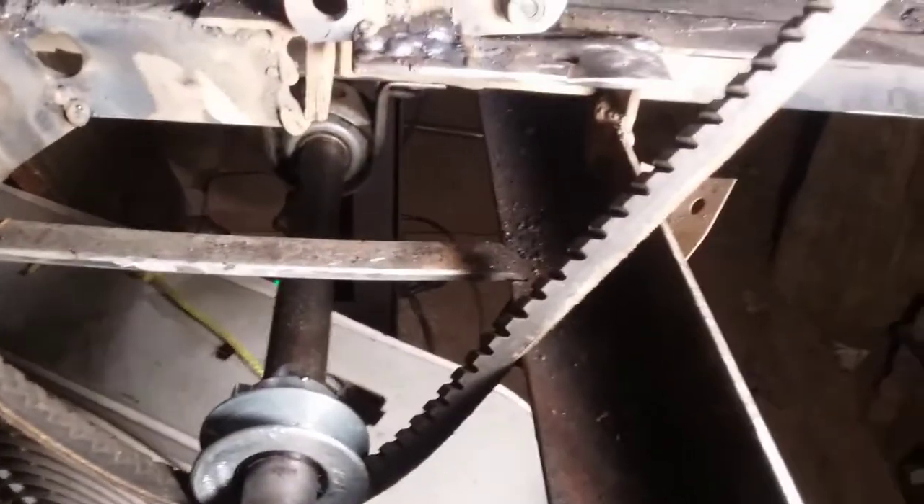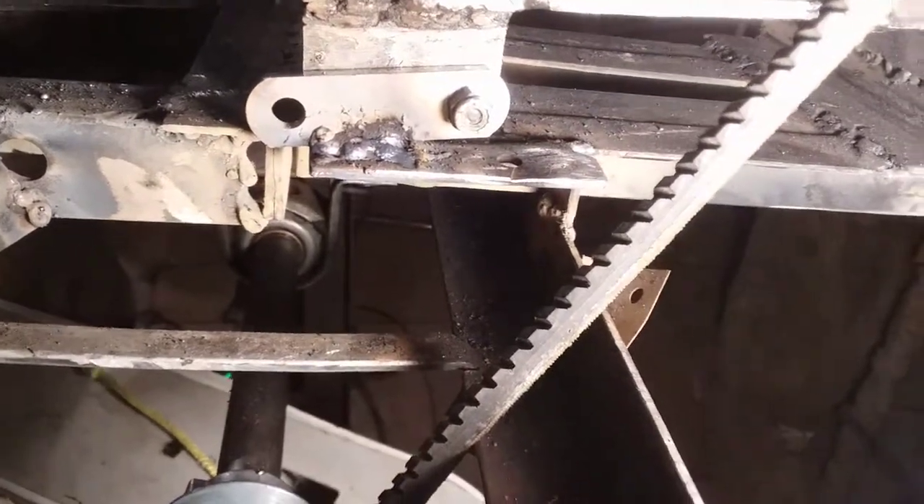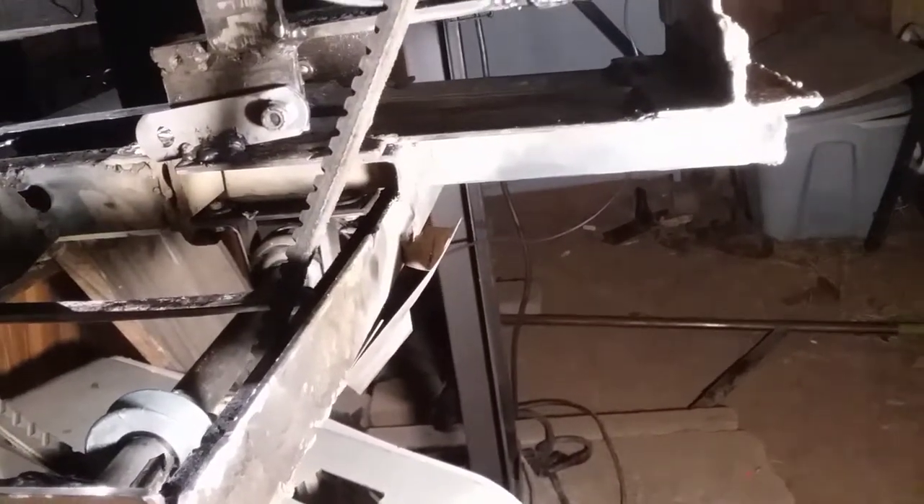There's another mount like this on the other side. You can unscrew those two bolts and then it's on a hinge back here, so I can change the oil — just pull that pin out of the hinge and the whole engine comes right off for service. All this is angle iron that I got from people throwing away their bed frames — that's what most of the go-kart is built from.